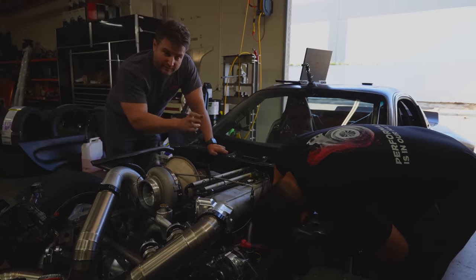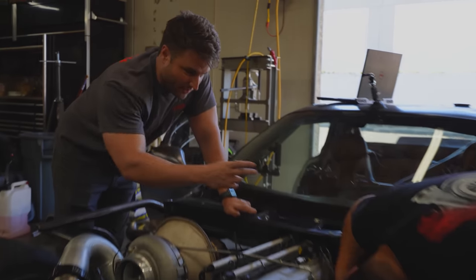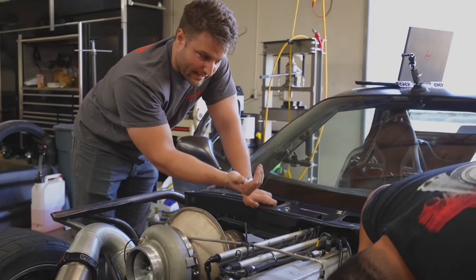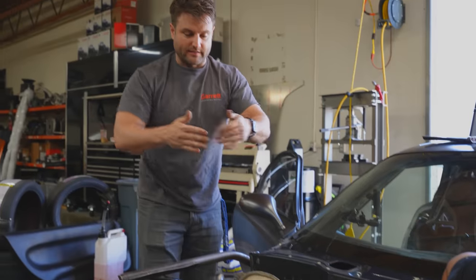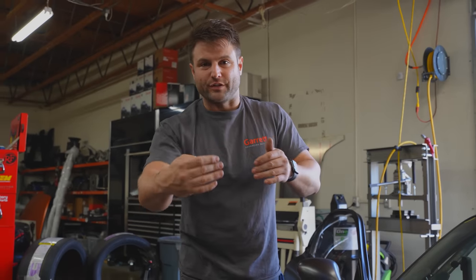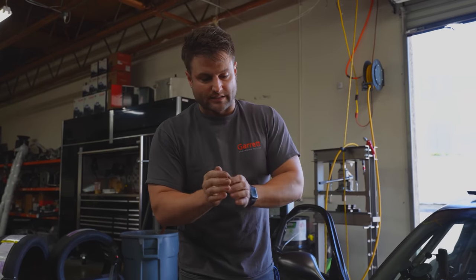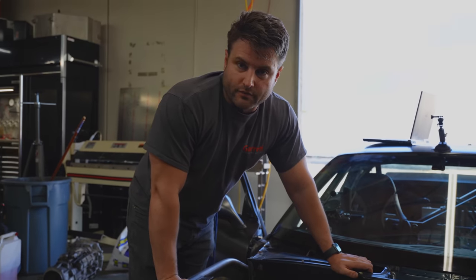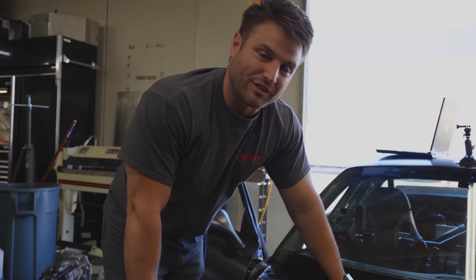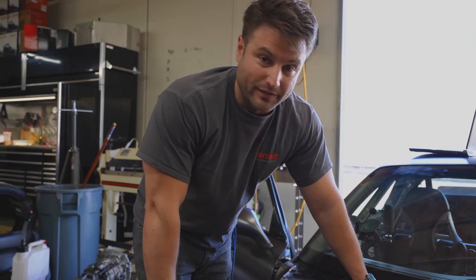So what he's doing right now is tightening the bar, the balance bar, so it's bringing the pedal closer to the front calipers than the rears. It's a balancing bar that's pushed in the middle, and the closer it is to one side, the more it is going to leverage that side. Shorter distance, it's trying to push that one, and the other one kind of has less to do. So we're going to move it a reasonable amount and then see if our stopping distance shortens and our tires lock up in a more predictable, appropriate manner.